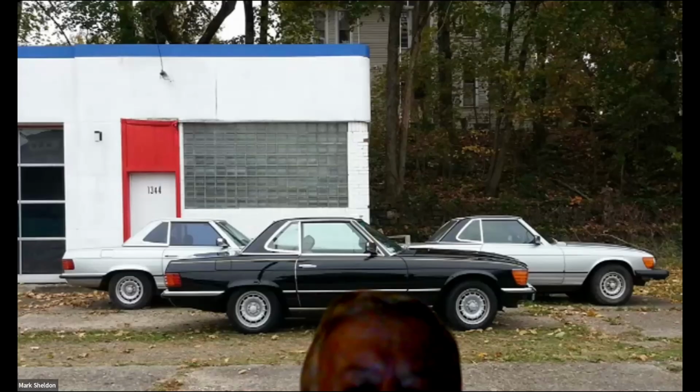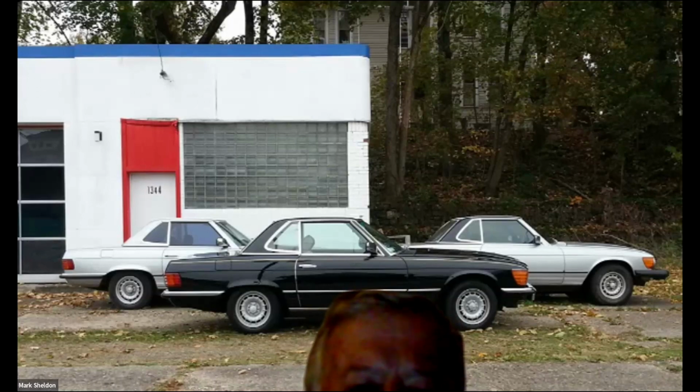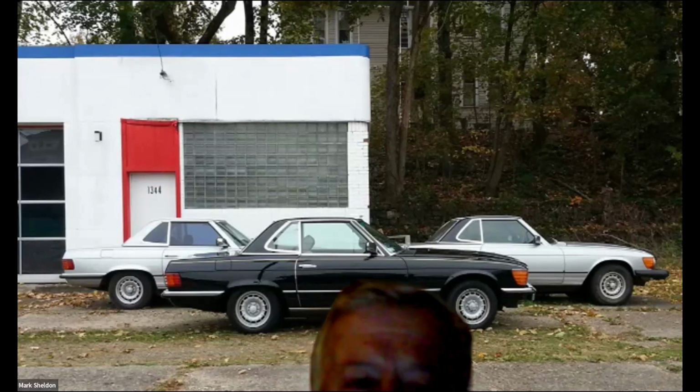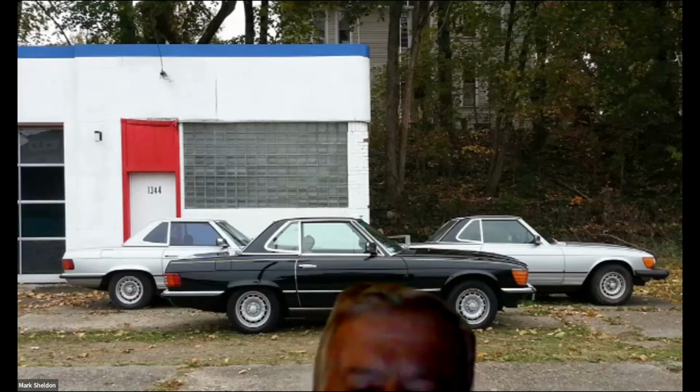And I have a suggestion. Sure, go ahead. Who is this? This is Mark Sheldon out of Pittsburgh. I had something similar. I used to take the battery terminals off of my 74 450 just as it sat, and I'd reinstall them, but I wouldn't tighten them. And I had the same thing happen. Intermittently, it would run and then it wouldn't start again, or it would die. And there's a positive, smaller wire connected. I assume it connected to the ECU or one of the other components that has to be tight, because if it loses any connection whatsoever, you lose spark, and you lose engine performance.